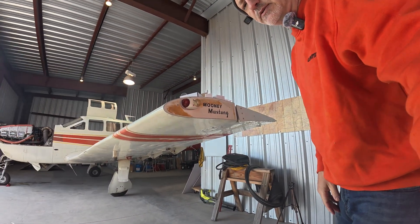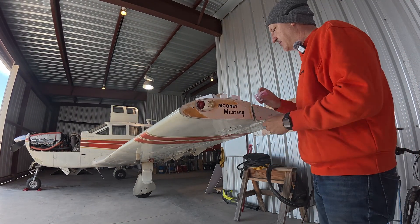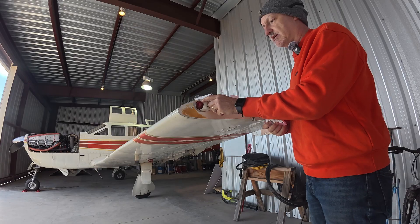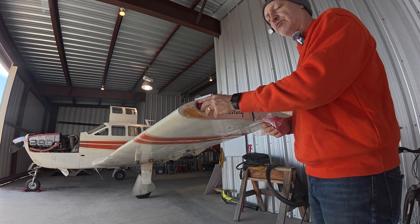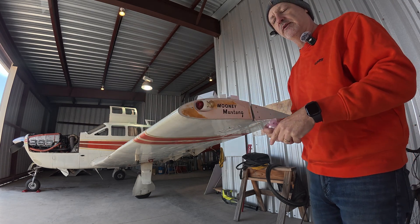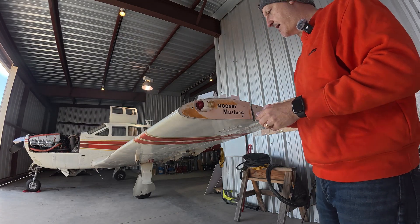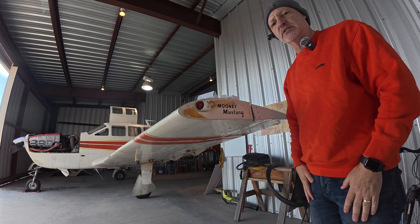Today I'm here, and we're all here together because I bought some replacements for the light bulbs. Simple job. I'll be replacing the light bulbs so that they draw less current, because I was getting a problem — they were drawing too much current and it was tripping the circuit to which the uAvionics tail beacon is connected. So if the circuit would break, ADS-B would stop working. So we need to fix that. Not a high priority, but I'm here at the airport and I figured I'd make myself useful.